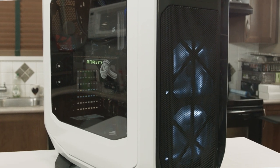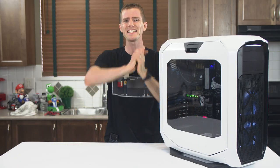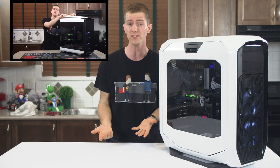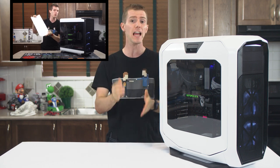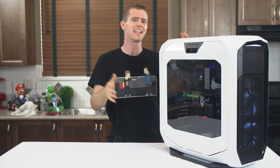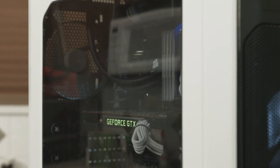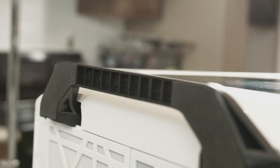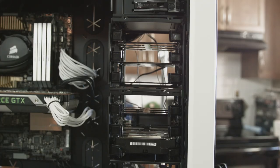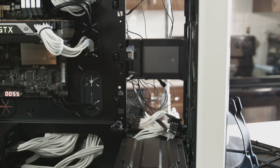Although some people may feel differently. To be clear, I'm not calling the case bad. And since it's a computer tower and not a support truss, in the real world it'll likely never matter. The 780T sacrificed some structural rigidity to the convenience and style gods, in exchange for a massive plexi window, stylish plastic feet that keep the case off the floor so a bottom-mounted radiator or PSU fan can still get fresh air, and reconfigurable drive cages that can be hung from the top, stacked from the bottom, or removed altogether to make room for a 280 or 360mm radiator in the front.